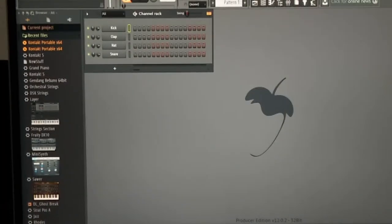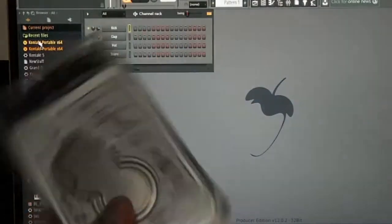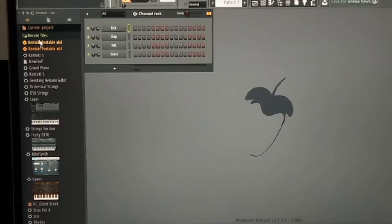So why do I need to install both the SSHD and the NVMe M.2 SSD? I'm using this laptop for music production. Most of the time, loading samples takes a long time, so in order to get fast loading I need to use SSD just for the music software portion. Windows OS will run on the SSHD — the hybrid hard drive — while the music production software will run on the NVMe SSD.